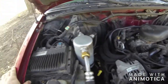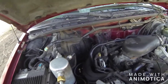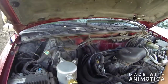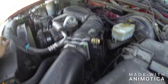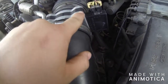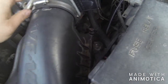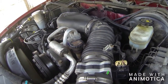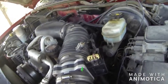The belt's not terrible, it's just cold. For the misfire it has, I'm wondering if it's the distributor up here, or maybe the wires or the plugs. The plugs actually look fairly new - at least cleaner. I'm going to have to pop this thing off. I really haven't looked at anything too closely yet.